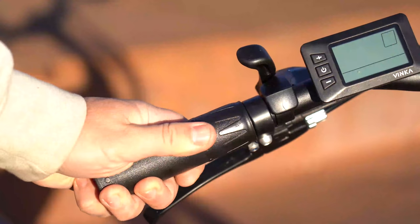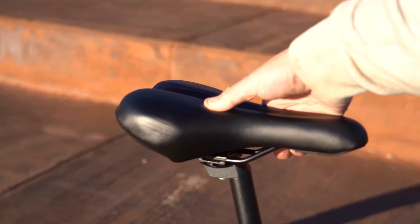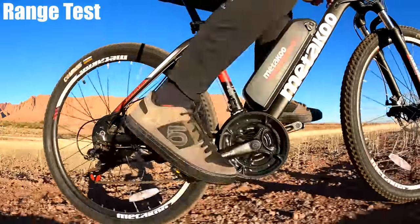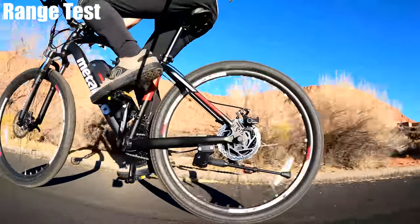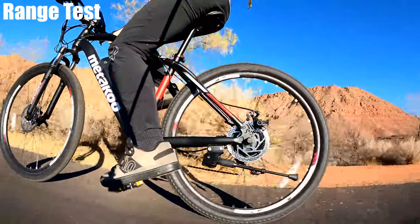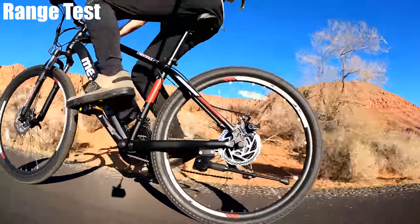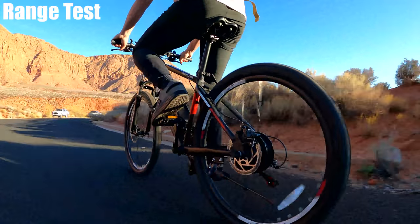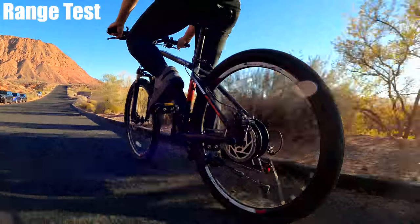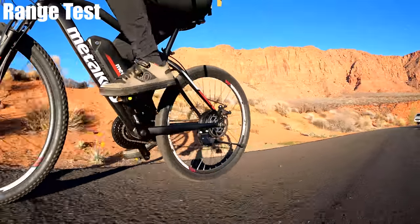The grips have a hard, cheap feel and aren't really that comfortable, and the throttle also feels cheap. The seat is pretty hard — you'd want some padded gear for long rides. The most impressive feature on this bike is how sensitive the pedal assist is. On most bikes, even higher-end ones, there's a half to one second delay after stopping pedaling, and two to three revolutions before power kicks back in when you restart. With the 300 it is almost instantaneous. Being under a thousand dollars, I was expecting a very long delay, and that's just not the case.